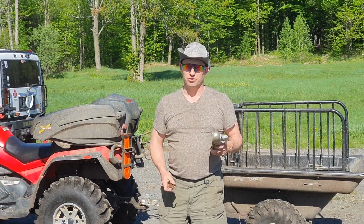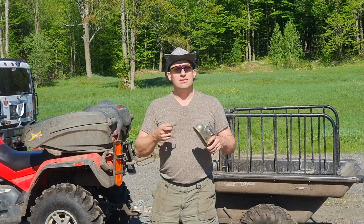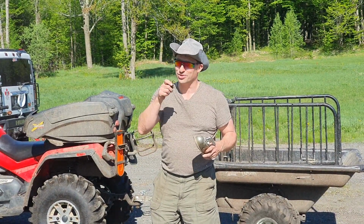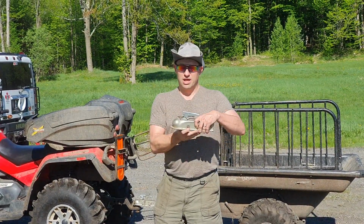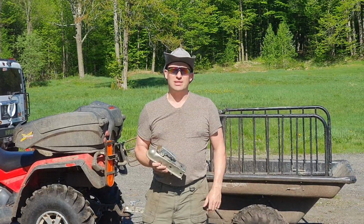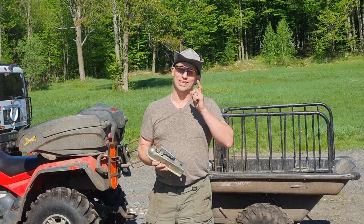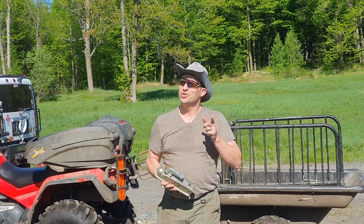Once you've confirmed that it's firmly locked in place, then take your lock, take your pin, take whatever you have that you are using for your trailer. I'd encourage a lock because you want to make sure your trailer stays attached to your truck. Take it, slide it through the pin, and lock it up. Then you know there is no chance that it's going to come off. It's a great habit to get into. It makes your towing safer, and it makes everybody's towing safer, and it allows you to have a happy towing season. And that's the very first trailering tip for summer 2022.